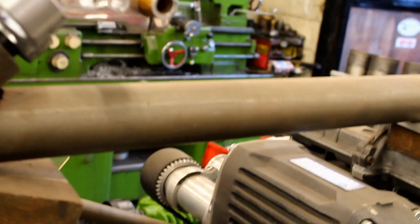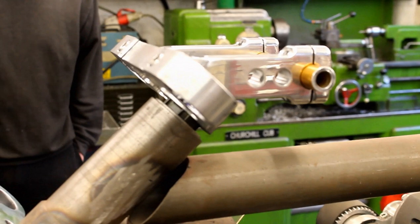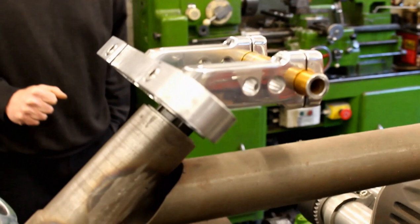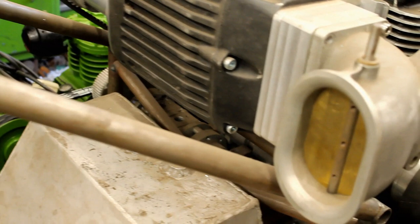The rake is set at 45 degrees which is too much. It needs to be 42 to 43 degrees - 42.5 degrees is the ideal. So unfortunately the two tacked-on pieces are going to have to come off, the setup rejiggled, and possibly the tube warmed a little bit to get the angle corrected back in. You live and learn - better to know that now rather than later.